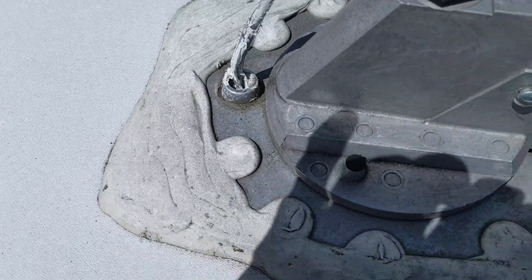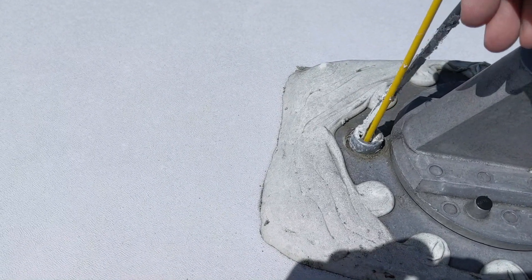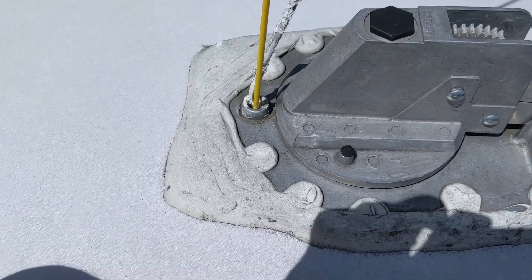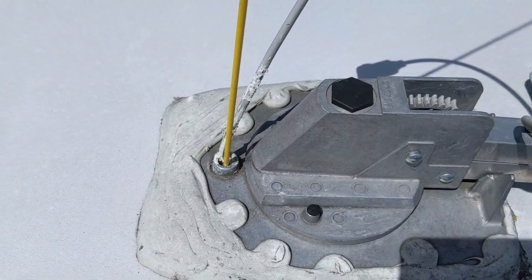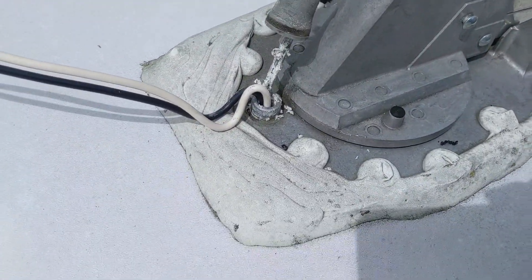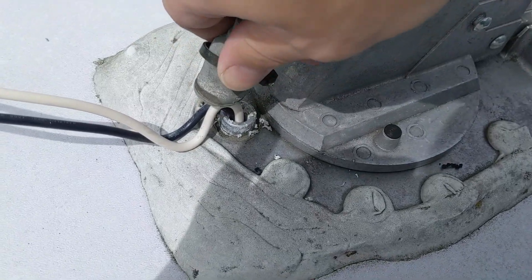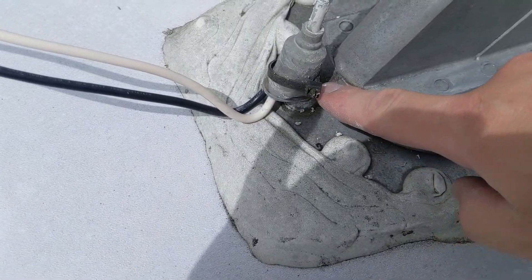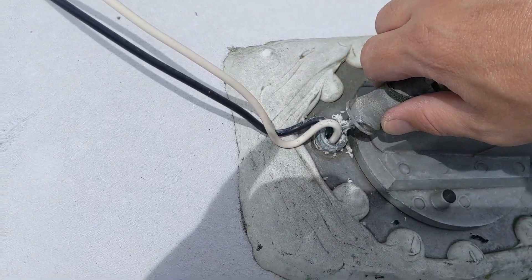It already goes right into the inside of the trailer. I use a little wire stick to push down in there — you can hear it hit the top of the inside paneling of the roof — so I think that's gonna work. No drilling, no nothing. I'll just have to reseal it since the boot won't be proper with the extra wire going through. I bent the wires up a bit so the boot can still go over them, and I'll put some Dicor down in the hole to seal it. No drilling — that's the idea.